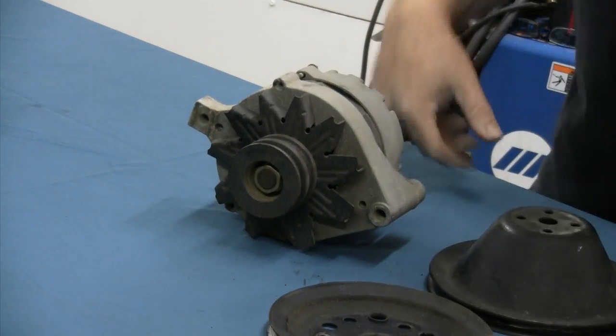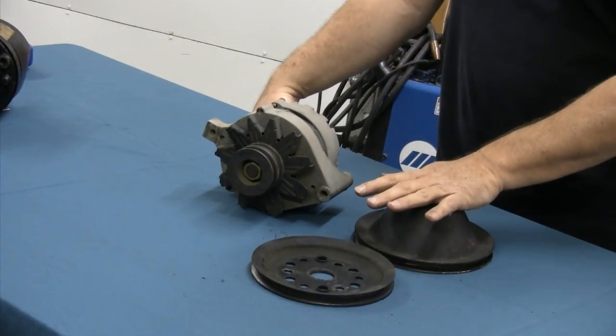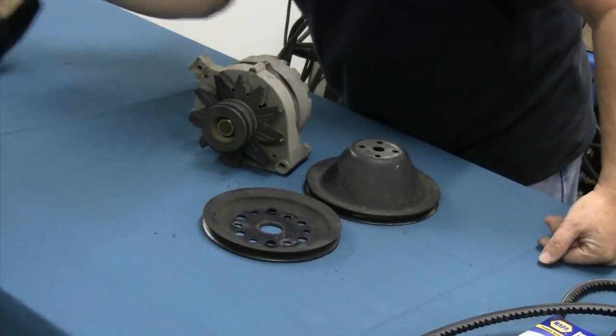If you're going to put underdrives on, do possibly your water pump and your power steering pump. Don't worry too much about your AC pump — you should have a switch so you're not running air conditioning at the track anyway, and running AC while flooring it can blow the compressor up. Power steering runs all the time, so that'd be a good place for a reduction, as well as your water pump. If your system's not in good enough shape for an underdrive kit, it'll show up with overheating problems before you even put it on. Now I want to talk about accessories and how to adjust them, and some things you might not know about adjustment points for your alternator and power steering pump.